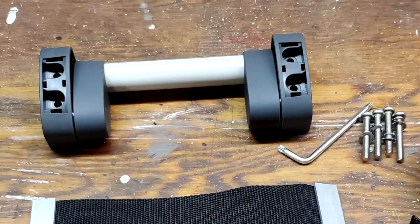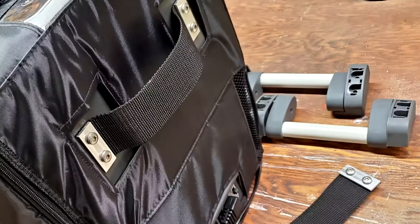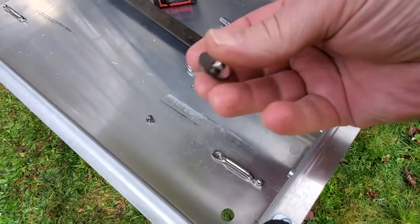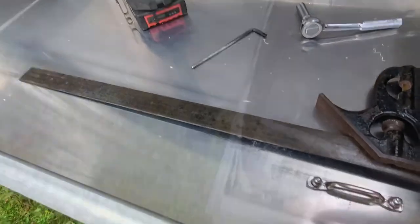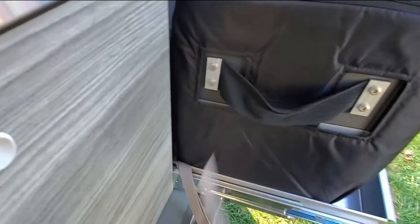The standard handles are replaced by 2-inch wide straps. The straps are reinforced by aluminum plates, or fender washers can be used. The pan is drilled for hold-down hardware. Adjustable straps hold the refrigerator in place and provide for easy removal — just loosen the two straps and it pulls right out.